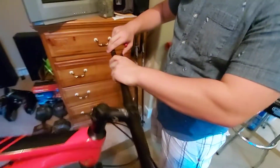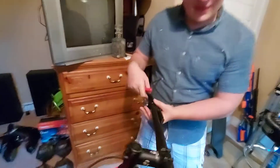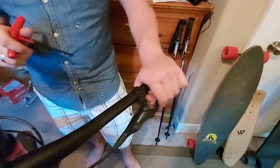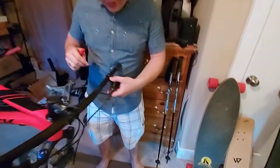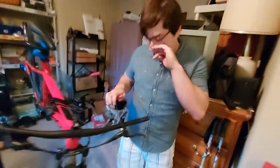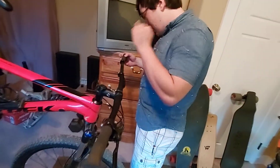I'm going to have it loosely on the bar and quickly feel it — I don't feel any creaking and I don't hear any creaking. I'm going to tighten it down and apply a little more force to see if it still creaks. If it does I'm going to cry in the closet and cut the video. No creaking — I would say that's a pretty good success. Moving the brake lever just in a little more — still no creak. I'd imagine when they assembled it they used a very light lubricant, and when it got absolutely hosed it probably washed away whatever lubricant they had.